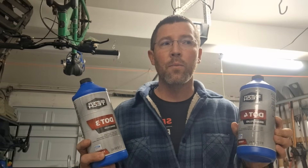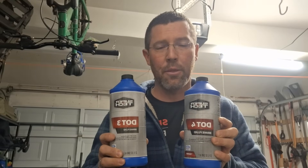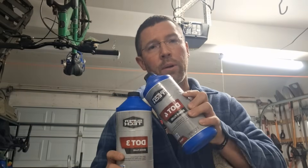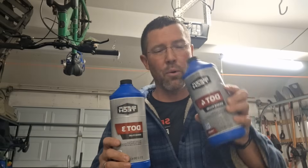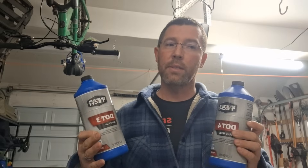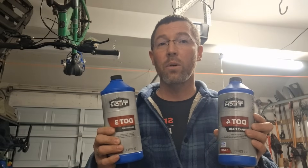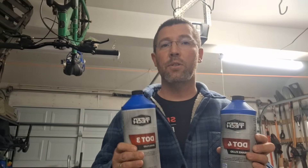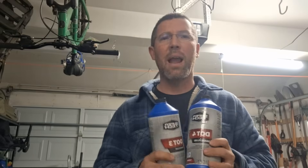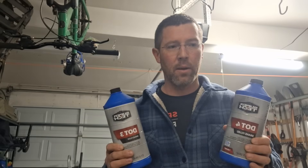What's the difference between DOT 3, 4, 5, and 5.1? DOT 4 has a higher boiling point and can completely replace DOT 3, but you can't go 3 into 4. DOT 4 into a DOT 3 system will raise the boiling point — you can mix those two. But putting DOT 3 into a DOT 4 system lowers the boiling point, and the system is designed for a specific boiling temperature. DOT 5 is silicone-based and absolutely cannot be poured into either a DOT 3 or 4 system — it will cause problems. DOT 5.1 is a different story, but most older cars use DOT 3. I bought DOT 4 because my Pilot requires it, and when my DOT 3 runs out I'll just continue with DOT 4.